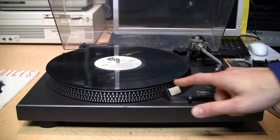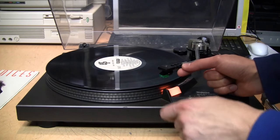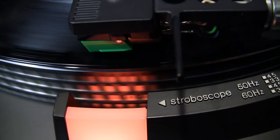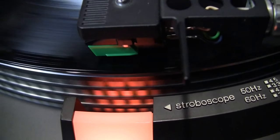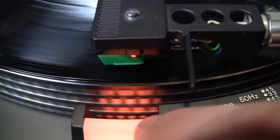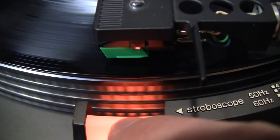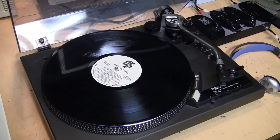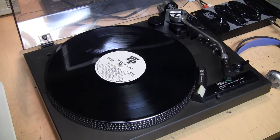One other nice feature: the strobe doubles as a tracking light, exactly lined up with the phono cartridge, giving you just enough light in a darker environment to see where you're setting down the stylus. It's actually a little neon bulb, not an LED. I also noticed that even without quartz lock, once set to the correct speed this turntable is far more stable than my AT-LP120, which would always drift back and forth — I could see the strobe dots going backwards and forwards constantly — while this one is rock solid, absolutely not moving once the speed is set correctly.